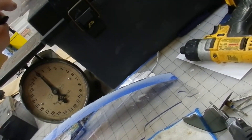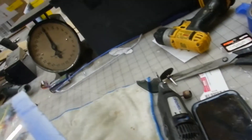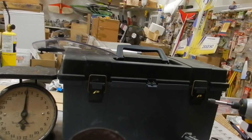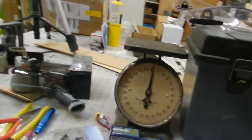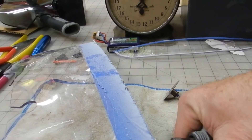The first hurdle was, of course, being scared to cut it. What did I cut it with? First thing I did was find where I wanted to cut, made my mark with some little dots, then came back and placed tape at those dots. This little thin cutting wheel on your Dremel — you don't want to run it at full speed, but you don't want to run it real slow either, probably about 75% of its capabilities. I found a way to keep my hand rested around it and just slowly cut, just barely scoring through the tape.